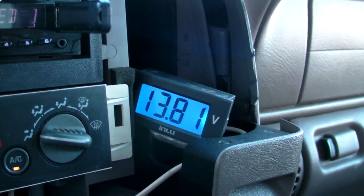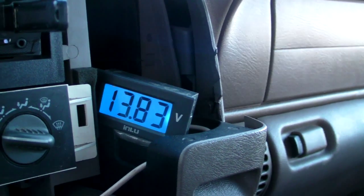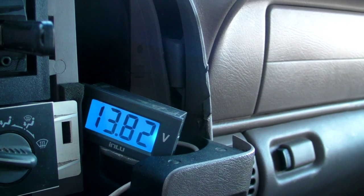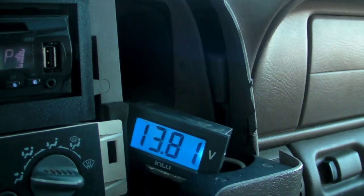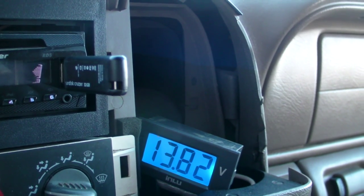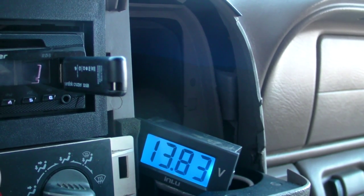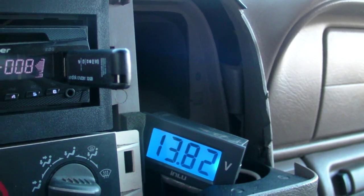So we're going to now see voltage — that's directly to the amp terminals, been DMM'd to be accurate. I'm just going to show you voltage drop with the high output alternator and a battery up front — like what would you see in a normal system? Let me put on a good song to show this, because it's not only the voltage drops you want to worry about — it's when your alternator is still outputting but the low resistance has gone away, so your voltage spikes up. You might see that on here. My alternator only does it a few times.